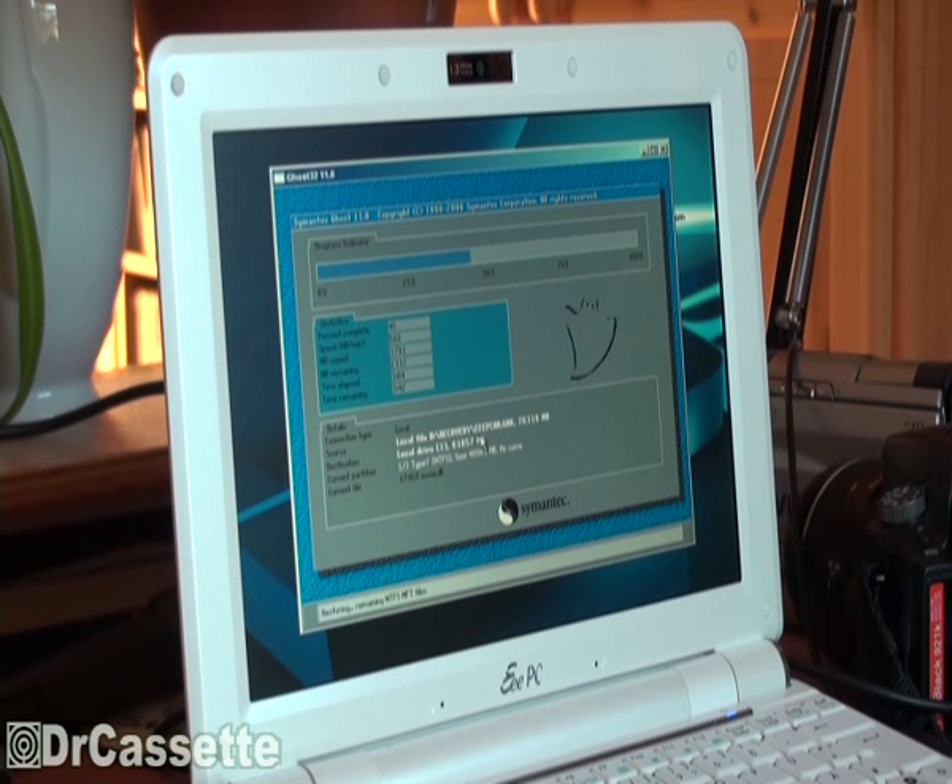The reason why I replaced the HDD in this thing is not so much because of the speed, though of course an SSD is a lot faster than an HDD. But I did it because I wanted to get rid of the HDD noise. Also, I wanted to extend the battery life, which I probably did. From what I read on the internet, you can extend your battery life by at least 30 minutes by replacing the HDD with an SSD. And since I don't want to buy one of those super huge batteries that sticks out in the back and looks rather ugly, this is the way I decided to go.